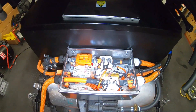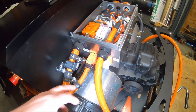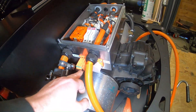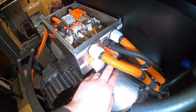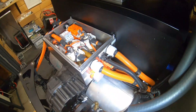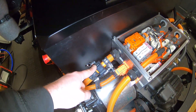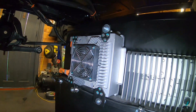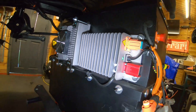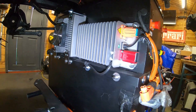These fuses will take the high voltage power from the battery pack and send it to the DC-DC and the charger. I've had to put in some special high voltage connectors — here's the one for the DC-DC, this one will be for the heater and aircon, and this side is for running high voltage to the charger — that's the T2C connector. I've basically done all the high voltage wiring here. This is my current sensor that will connect to the Orion BMS, which will sit above it. On the front of the top battery box is where I decided to mount my DC-DC and my Elcon 6.6 kilowatt charger — it meant I had to take all the batteries out of the top box again to attach these because I had to drill holes in the box, but it's the perfect place for these items.